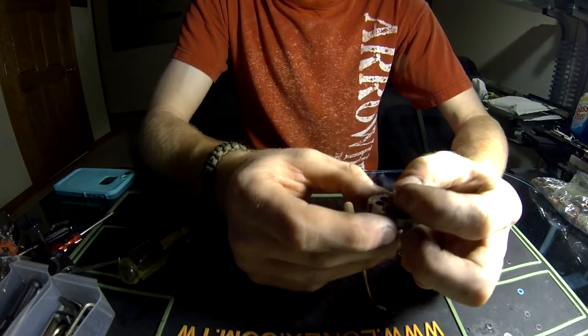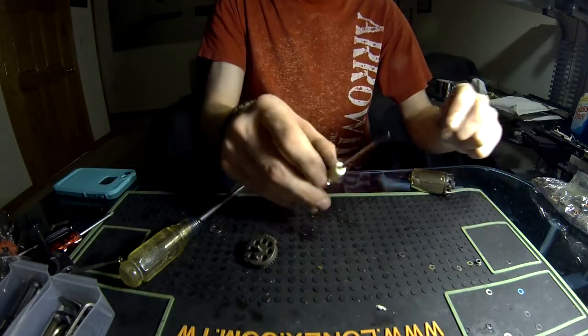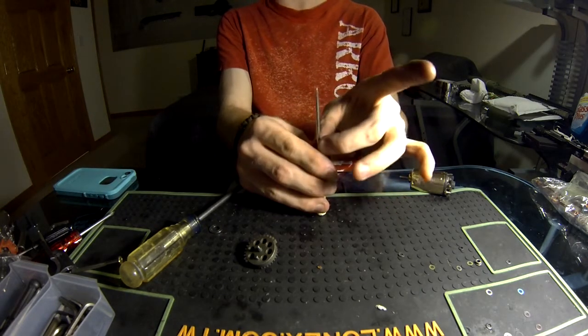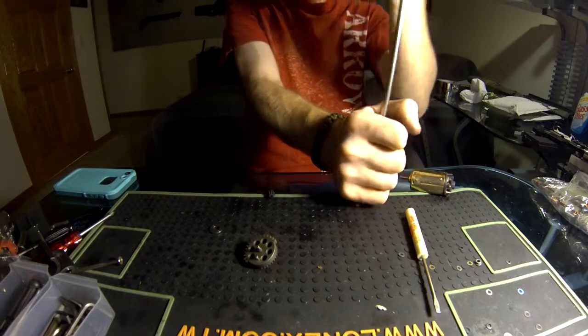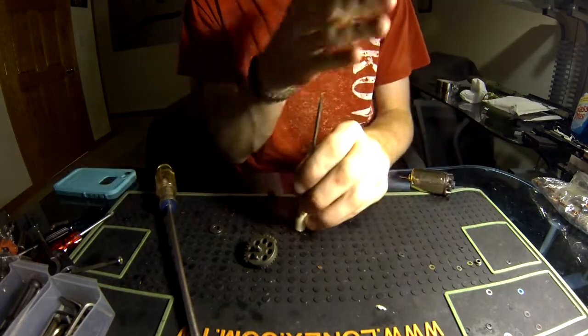Now imagine if it was all the way risen up, and it's just barely making contact. Imagine what that does. This is our axle, and this is our bushing. Sits good. There's a top portion and a bottom portion. But if we have it all the way up top, more pressure. It's like all the way up on your bat, and it's pulling it down, because it puts more pressure and makes it easier for the axle to break and bend.